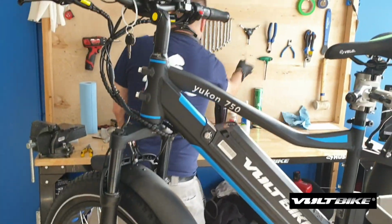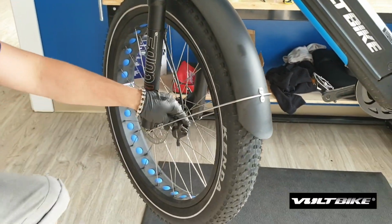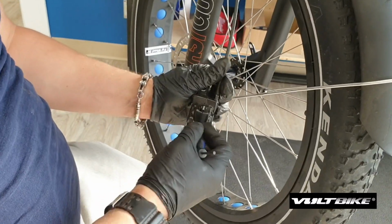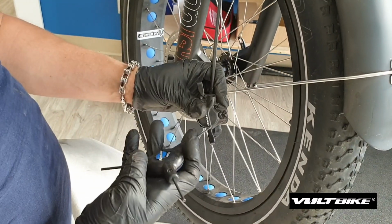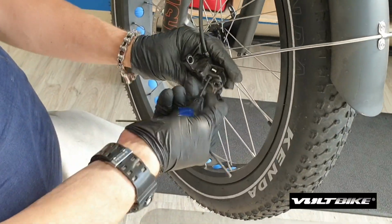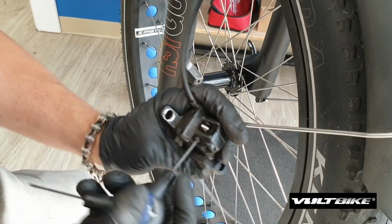So next, you're going to be removing the pads themselves. So these guys, some of them use a cotter pin, which is basically a pin that's got one side a little bent up to keep them from falling out of place. This particular caliper uses a bolt. So it's a 3mm Allen key on that guy, and we just spin that off. As you can see, it goes all the way through.